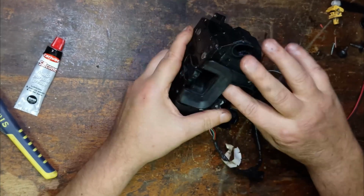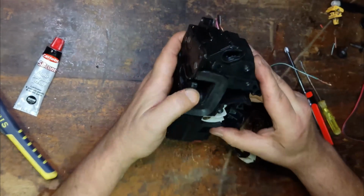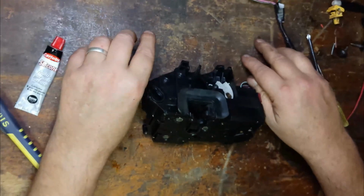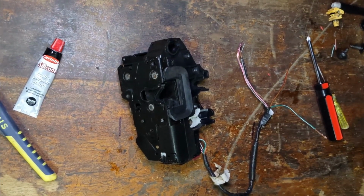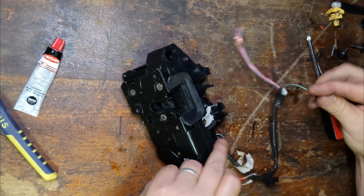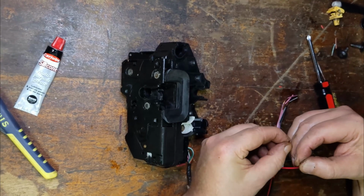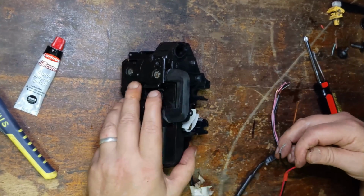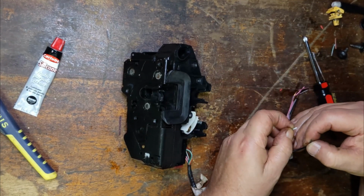It all works really smooth now. And out that way. Lock the car. Beautiful. Oh well, there you go. Well, there's not much more to explain there. We'll just add power for one more go at it, I guess. So if you lock the car, okay, so power to green, earth to brown, we'll lock it. Earth to green, power to brown, unlocks it.